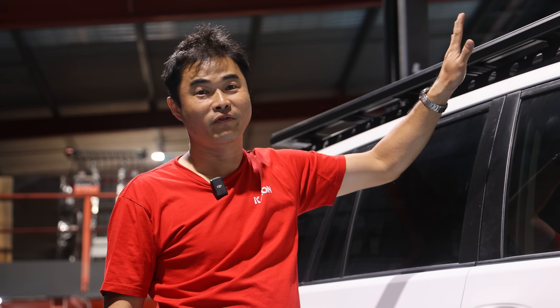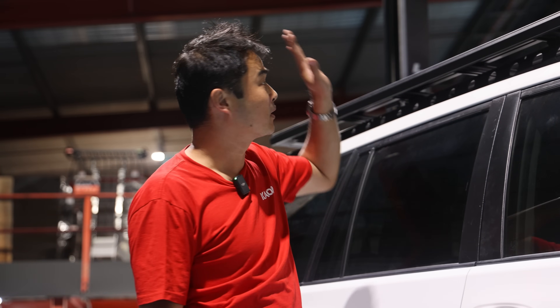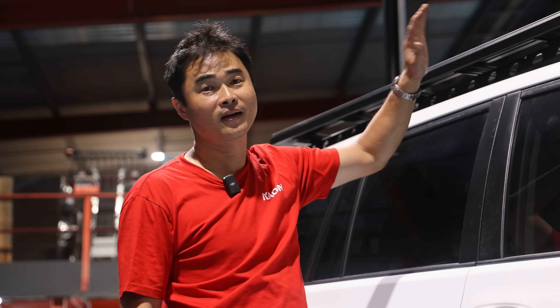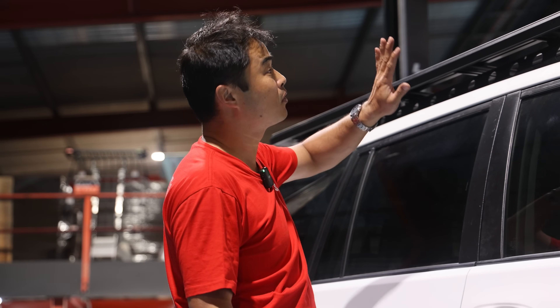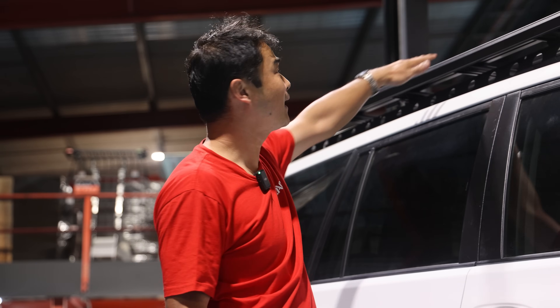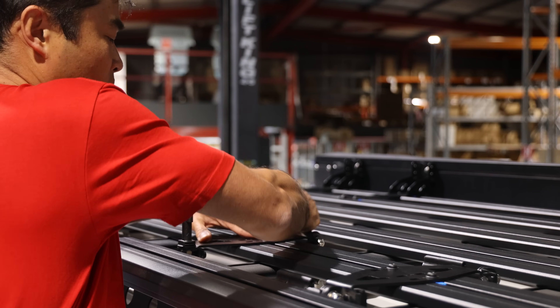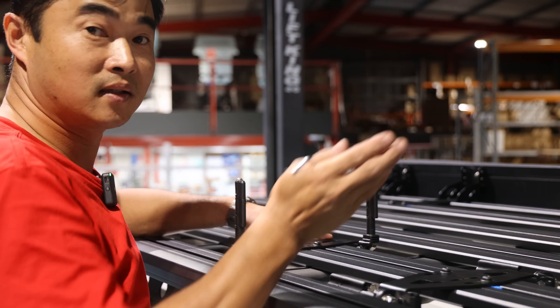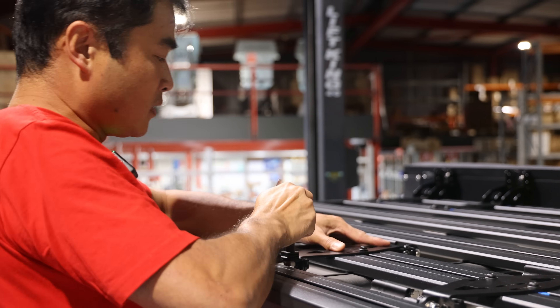Because we're going to be taking this car off-road, self-recovery traction boards are a given. We're going to install some MaxTrax on the roof rack - a really good place to put them because they'll get dirty and take up space. We're going to put them on with our stealth mounts that fold away, which gives you flexibility with what you want to do on the roof rack. All the pins fold backwards so just in case you forget to put your pins down, they'll fold down by themselves.